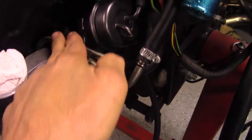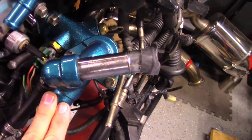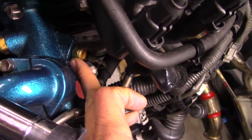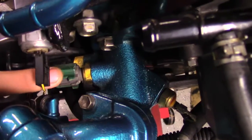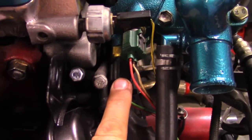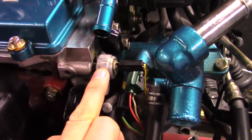These lines right here are your coolant lines for your turbo and they run up into the water neck housing. This is your water neck housing and there's some sensors on it. This one right here under the distributor is your coolant temperature sensor for your gauge inside the car. This green one right here is the coolant temperature sensor for the ECU. And under that one — you can see it in black right here — this is your cold start timer injector switch. And right above that is your low oil pressure sensor light.